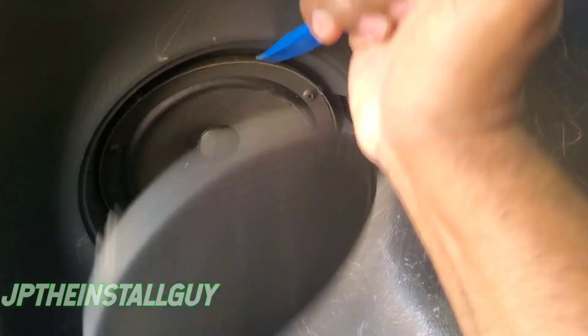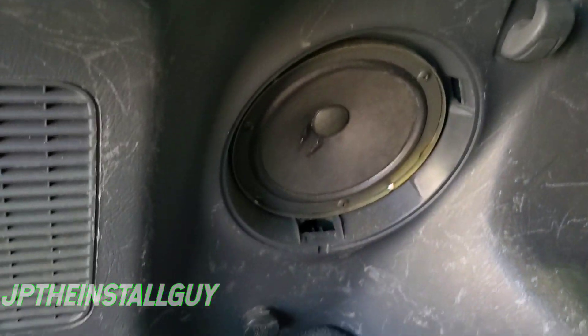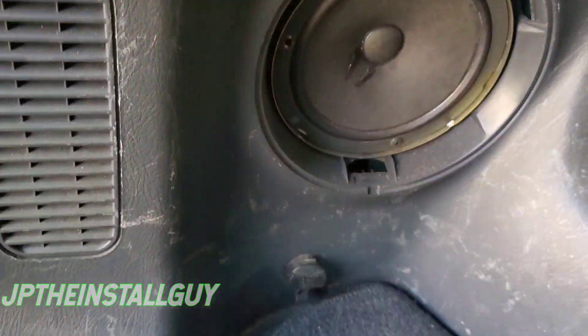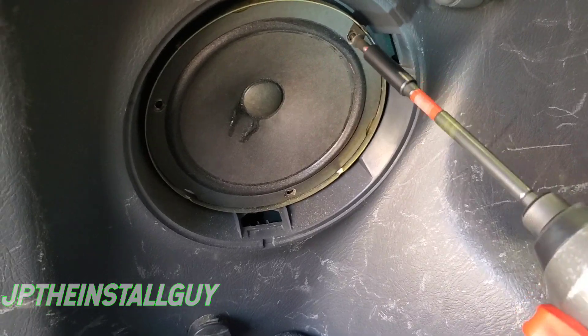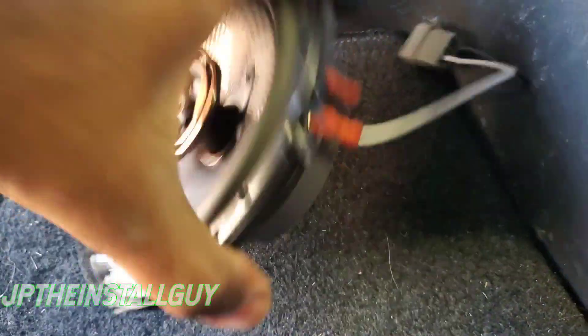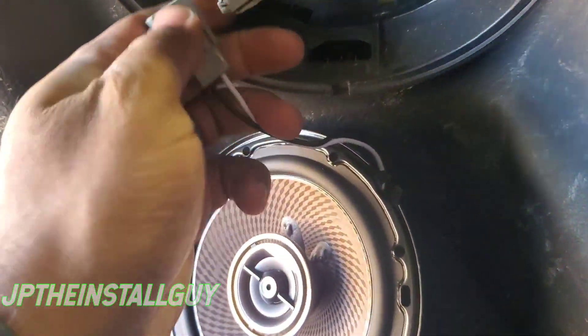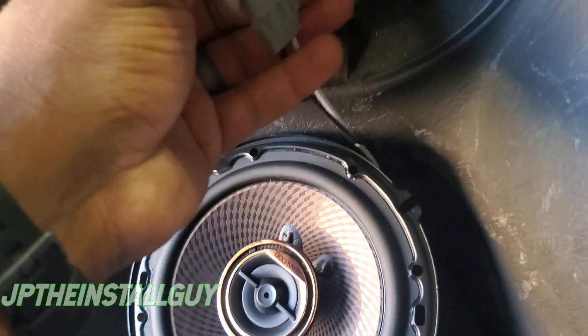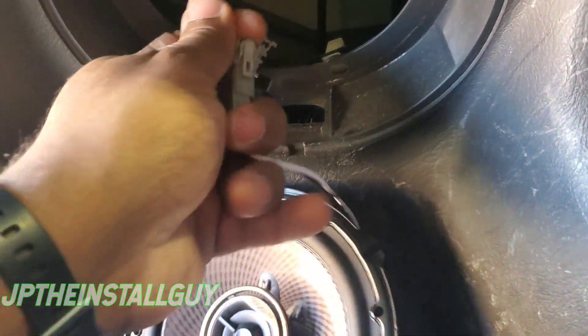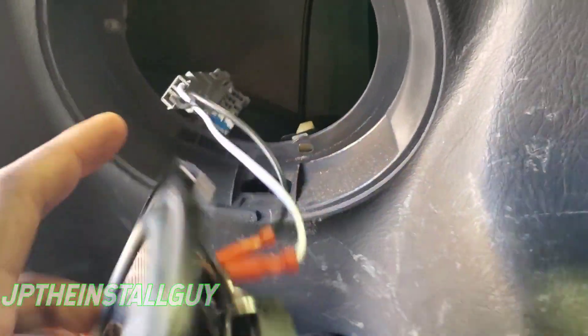We are at the back — actually in the rear cargo area, not the rear doors. To do the exact same thing, it's almost even easier. Take that grill off, three screws. Take out the harness just like that, have my aftermarket speaker with my speaker harness already attached, plug it in with one hand like a boss, screw the speaker back in, and there you have it.